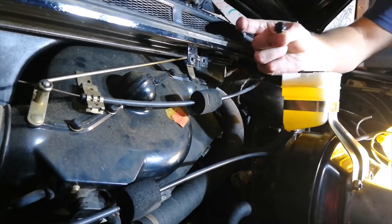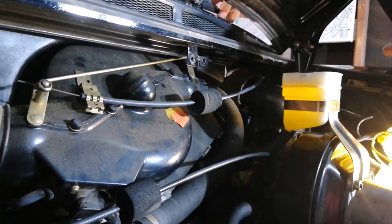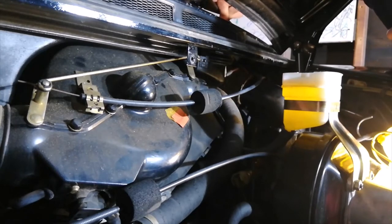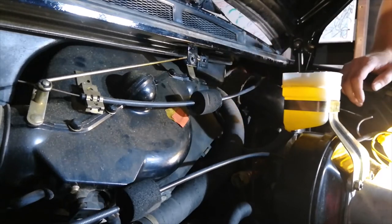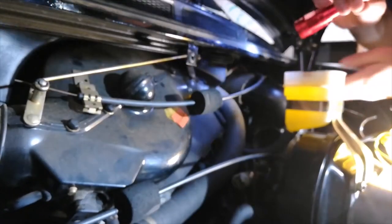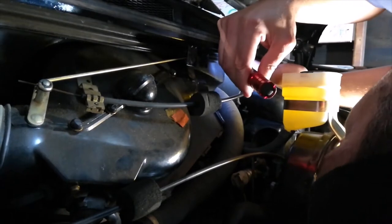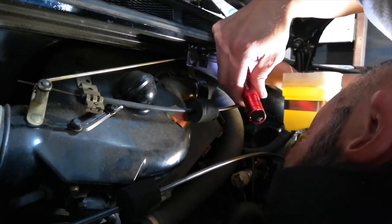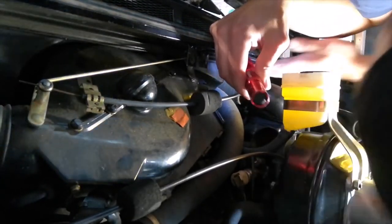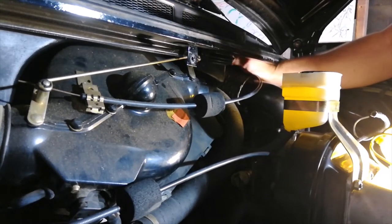After the home stretch, grab the driver's side nozzle, pop it back in. Okay, it's in there. Try to push it out with your other hand just to verify that it's locked in place, in which case it is. Now, grab the rubber hose on the T-fitting and reconnect it to the bottom of the nozzle. You could probably do this by feel, but I'm going to take a look at it on my side. Okay, now it's on nice and tight. Give it a good push. Make sure both ends of the rubber hose are connected to the T-fitting and the nozzle.